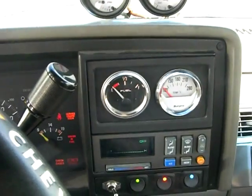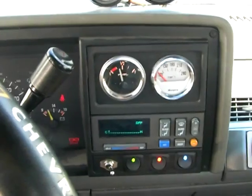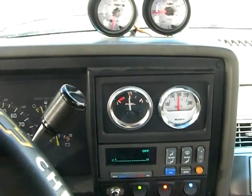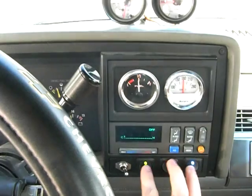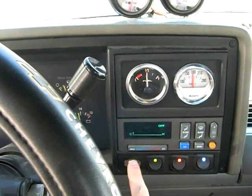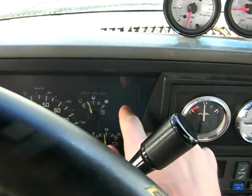I just had this running so it's all warmed up already. Here we are on veggie - that's that. There's my conversion. You can see right now I've got my pumps on, my glow plug heater on, return line back to my veggie tank, and I'm switched to the right which is on veggie. I've got a half tank of veggie and only a quarter tank of diesel.